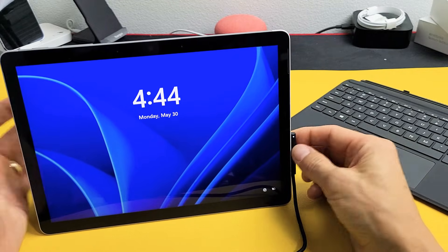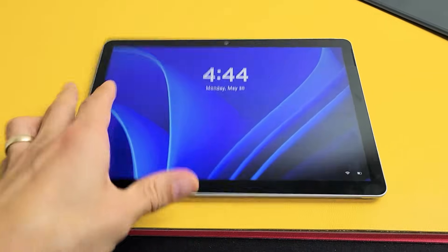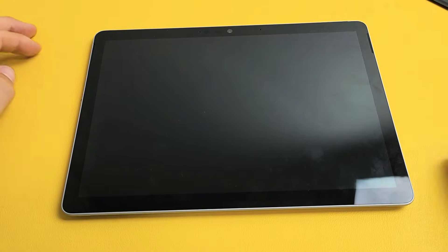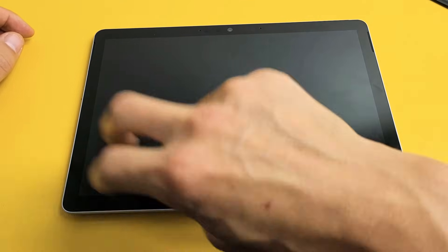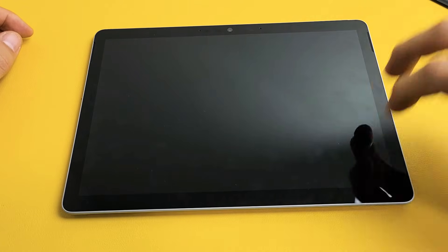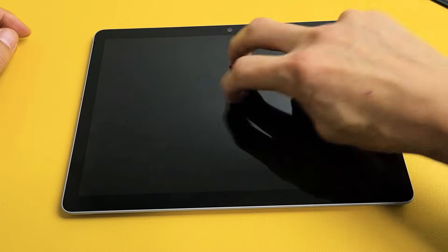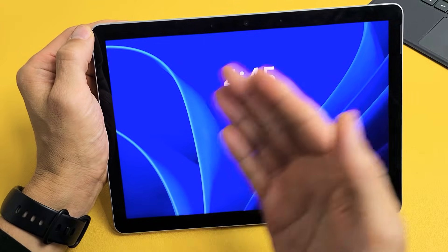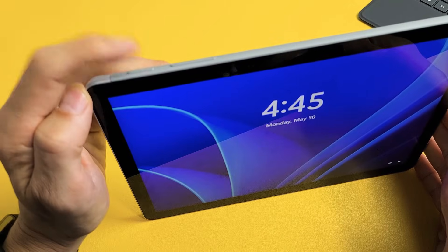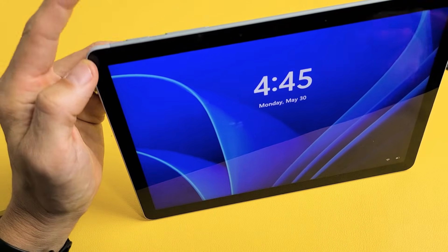If you're still not up and running and you still have a black screen, we're going to go ahead and unplug it. Then lay the PC flat like this — this is what I call the tap method. Simply get two fingers, put the PC on your desk, and tap kind of hard on the screen itself. Just keep doing this — sometimes you might get half the screen, or white lines that pop up, or sometimes nothing. Just keep tapping kind of hard everywhere. Then tap your power button and see if your screen is on. If it's still black, press and hold the power button — do not let go until you see a Windows logo. As soon as the Windows logo appears, let go of the power button quickly.